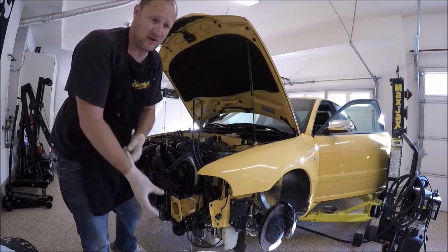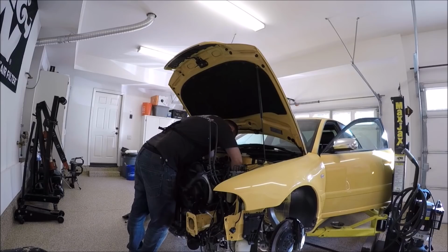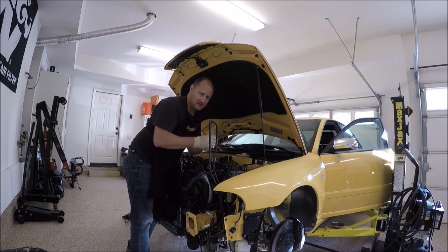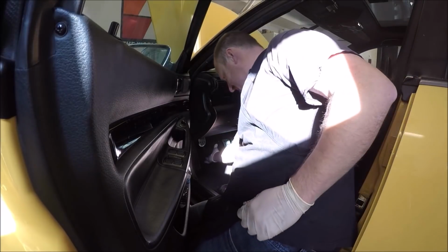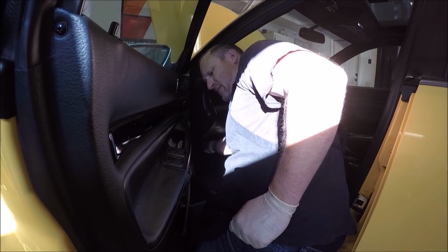I could hear it dripping into the pan. And then next, I'll walk you over here if you could just see. I'll push this in. And then I'm gonna go ahead and tighten the valve. Remember that valve is plastic, so don't over tighten it. Just tighten it so it's tight, but don't crank on it. Let's go back and pull the pedal up. I'm just gonna slowly grab the pedal. Oh, wrong one. And just slowly pull it up.